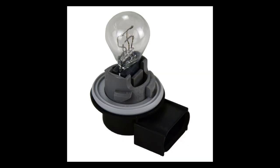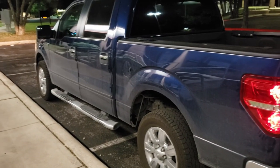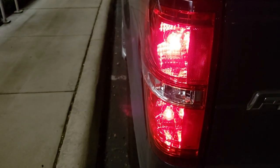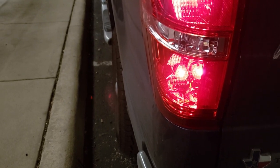It doesn't always mean both your bulbs are good, because they have two little filaments inside each bulb. So each bulb, even though it may come on with a light, the other little one might be bad and you do need to replace the bulbs. That's the first thing you check. When you get the quick flashing signal on one side, it's usually a bulb. Check all your bulbs first, and if you can see it's one of your taillights causing the issue, just replace both taillights on that side. Get that problem out of the way. That's the troubleshooting step. Once you've done that, you know it's not your bulbs.